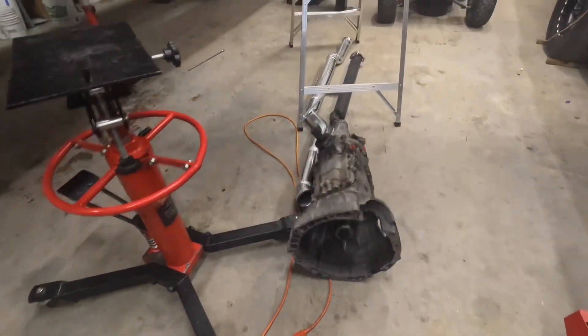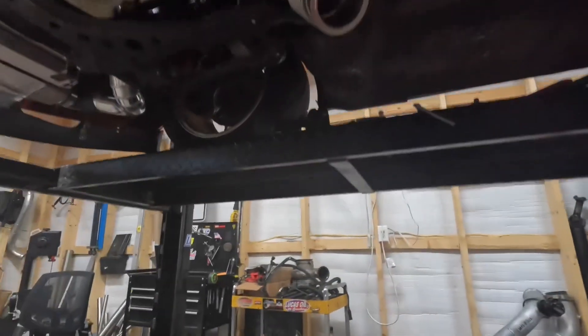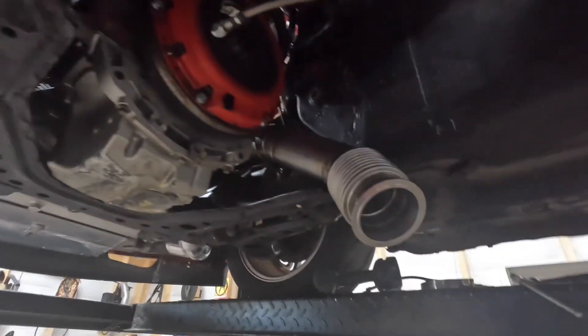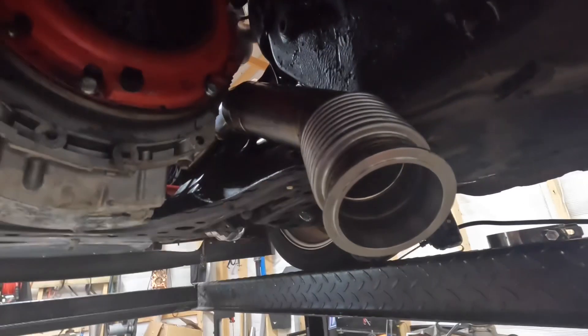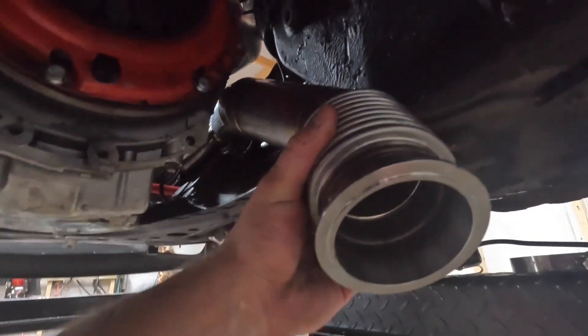That was a royal pain in the ass — finally got the transmission out. I was struggling really bad because this down pipe needs to be cut into two parts like I mentioned, since I couldn't get this bellows around the transmission tunnel. And since we added the wastegate return tube right there, I can't pull it down either. I'm going to try pulling this out, get more room, raise the car back up, then dive back in — but I need a break.